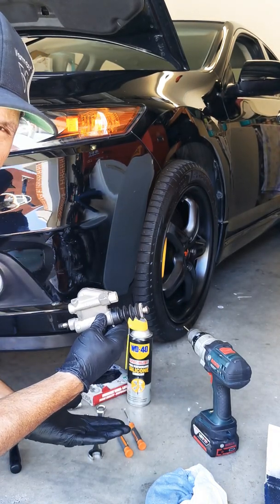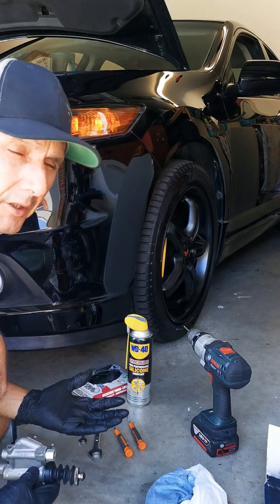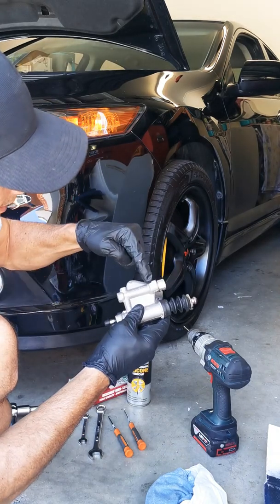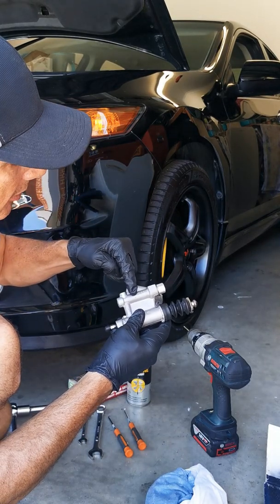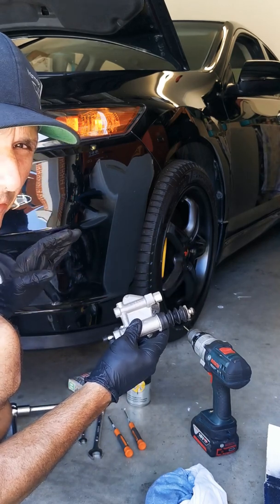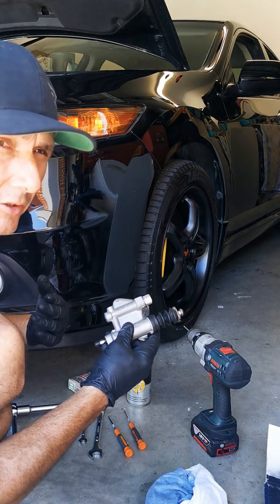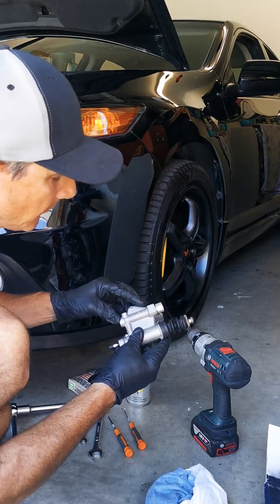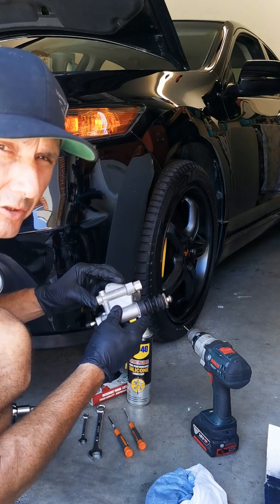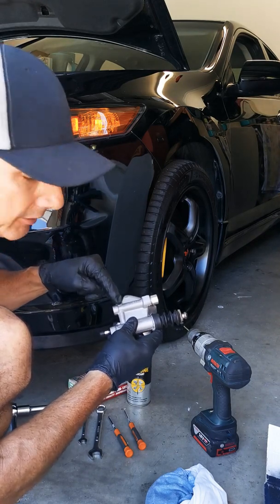I've removed the whole thing with a container underneath just to catch the excess fluid that's draining out. What we're wanting to do is remove this part here, which actually restricts the flow of the clutch fluid when you're pushing in and releasing the clutch. If you're trying to shift quickly, often what will happen is you'll grind your gears because the clutch is not actually actuating quick enough. Honda have done that on more of the modern Hondas to avoid any transmission damage, but really it's about mechanical sympathy.